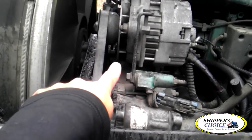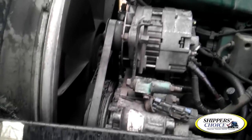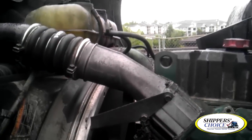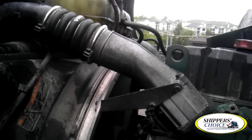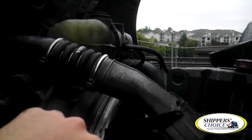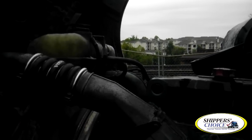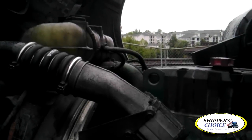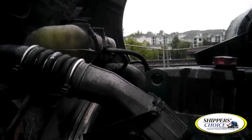Your water pump — you can get by with just pointing inside the engine, usually up in the block. It's not cracked, bent, or broken, properly mounted and secure to the vehicle. This is gear driven and you don't see any leaks. Your air intake hose — the metal portion is not cracked, bent, or broken; the rubber is not cracked, dry rotted, or broken, and my fittings are all tight. My coolant reservoir is not cracked, bent, or broken, filled to the proper level. Through the sight glass you can view the level, or if not equipped, you wait for your engine to cool. Remember, do not remove the cap on your test. Check the hoses as well — they're not cracked, dry rotted, or broken, fittings are tight, and you don't see any leaks. You'd also refill your reservoir on top if not equipped with a sight glass.